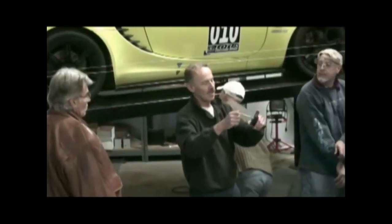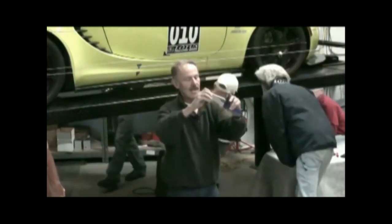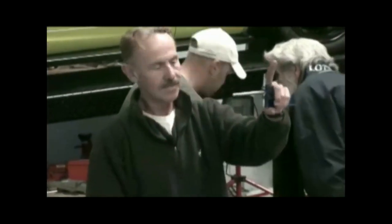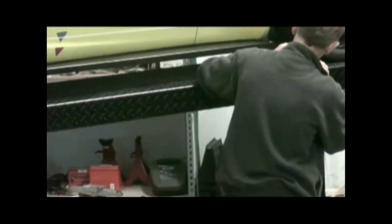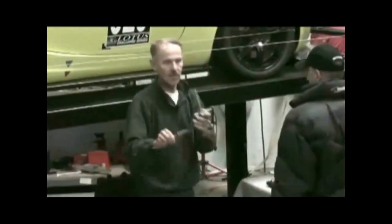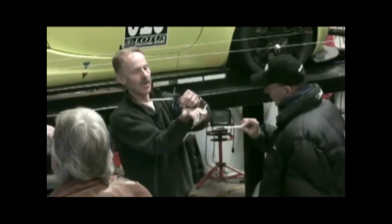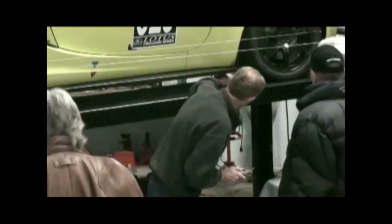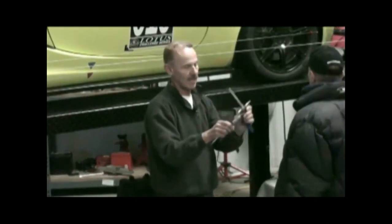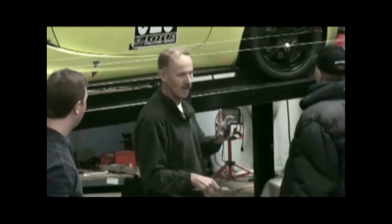What I made is a very simple tool — it's nothing more than an expandable feeler gauge with a way to keep it square. I slide this under the car and let it click under the frame, then take your vernier calipers and you've got your reading. You do it on both sides — it's very accurate. The tool sits on the floor, and the gauge extends up to the frame. Push it down, let it click up, lock it, and that gives you your ride height reading — front and rear, left and right. You're well within a millimeter, and it's the most accurate way of doing it.